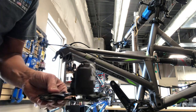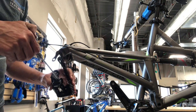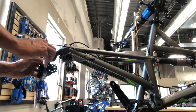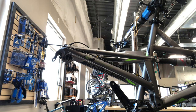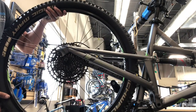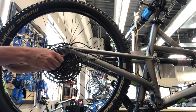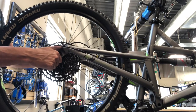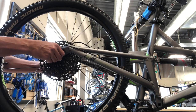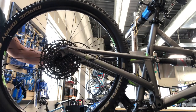That's one thing I like about the Wheels Manufacturing replaceable dropout hangers — they're just the right amount of stiffness to give you a nice firm holder for the derailleur and nice firm shifts. But if you do bend one in a crash or whatever, they're pretty easy to bend back a time or two. They're all machined out of aluminum, so the quality and the looks of them is really nice. They always fit — as far as all the specific widths and everything else — and I've never really had any issues with them.